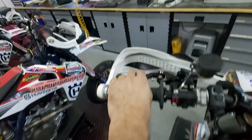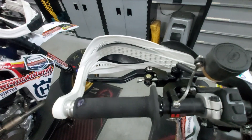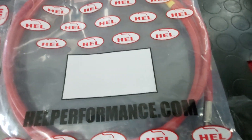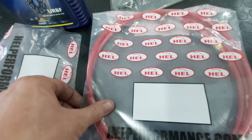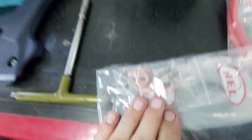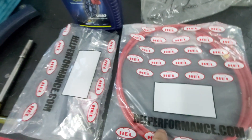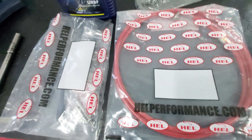We're obviously going to test this — we haven't actually run it yet. We're going to test it and see how strong the finger brake is. It's a 13mm piston so we feel it should be strong enough, but we'll test it. They gave us another brake line — they make all these brake lines with whatever ends you want on them, done to your spec. You just measure up your motorcycle, take some photos, send them through and they'll make up a line for you. We've got this extra long line which will go straight from the finger brake to the rear caliper, so we could do away with the actual foot brake mechanism if we feel we've got enough feel and strength in the finger brake.